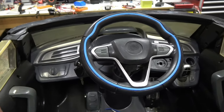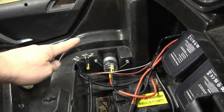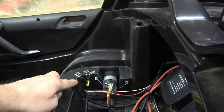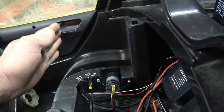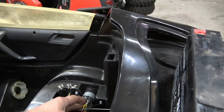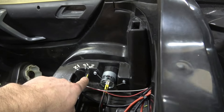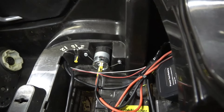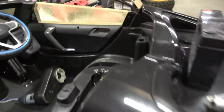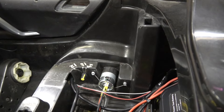The secret that keeps these motors from turning into plasma is this potentiometer on the signal wire of the gas pedal. I'm able to cut down the voltage going to the motors. I hooked up a voltmeter and gauged where 24 volt, 18 volt, and 12 volt positions were. Right now it's turned up to max — we give it gas and these 12 volt motors are spinning. Any more voltage than that and it will turn them into plasma.